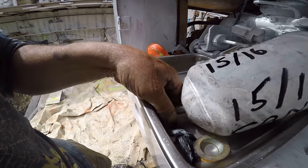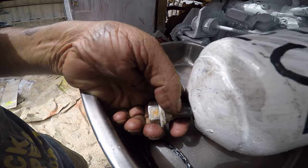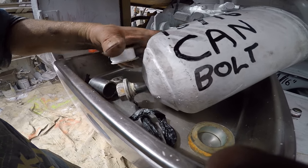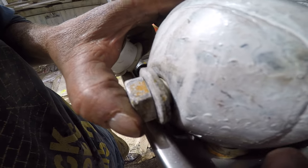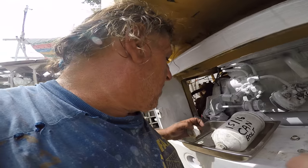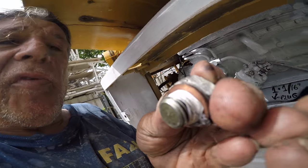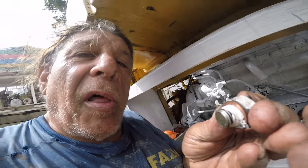This O-ring is old but it works, and I filled it up with Teflon tape over the O-ring so that the bolt now seats into the hole tight. When I tighten the bolt it will be sealed by the O-ring plus the Teflon tape. I do the same thing for the oil drain plug — this way that bronze ring is not taking up 100% of the sealant, and the Teflon tape acts as a form of thread locker.